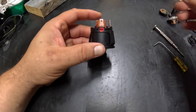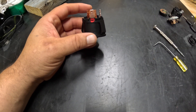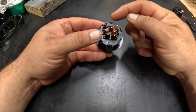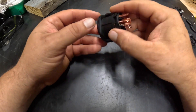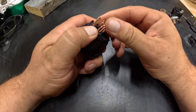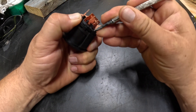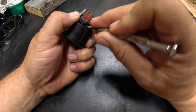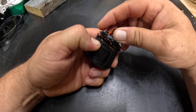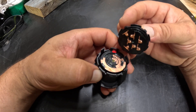The most important thing when disassembling this is to mark the orientation using paint pens — give the paint a little time to dry, otherwise you'll wipe it right off. Notice that this end up here is small and this end down here is big, so mark the top orientation clearly. When you pull this piece off, be careful — a piece inside may want to fly off, and you definitely don't want that. Pull it off slowly so you can see where everything is.